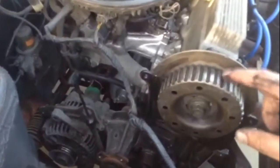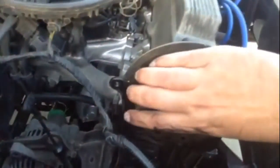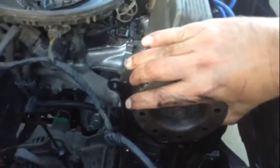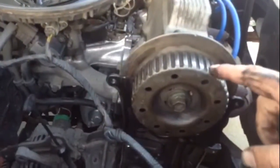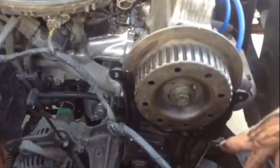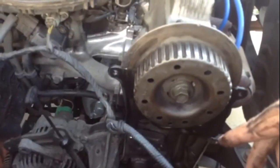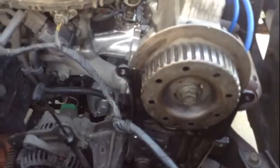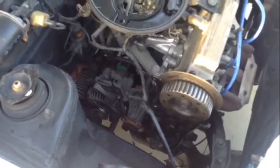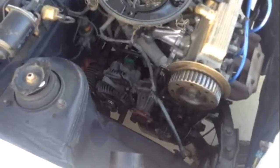In diagnosing this, chances are you've got to have the distributor cap out so you can tell the positioning on a lot of stuff and make sure that when this turns, this turns. It's going to be a little tricky to turn because you're fighting against the valve springs. We're going to get this thing lined up and show how to install it in the next segment — it's pretty much reverse order. Relatively simple and easy to get at, and you're going to save yourself about $400 doing this yourself.